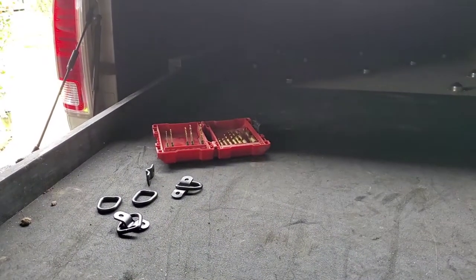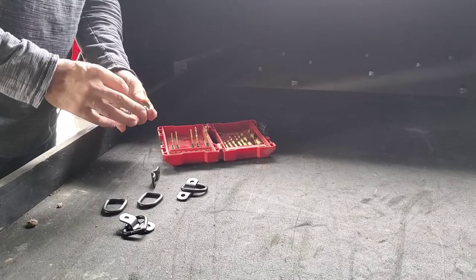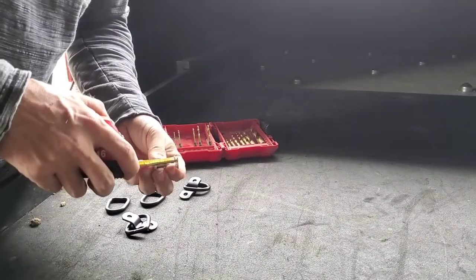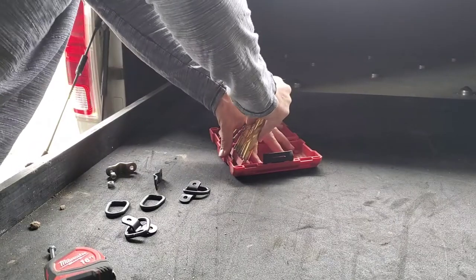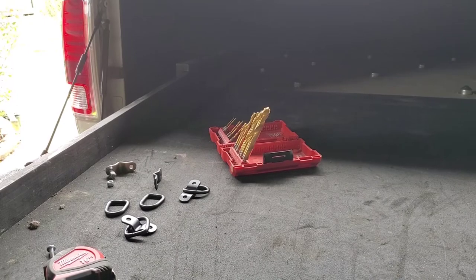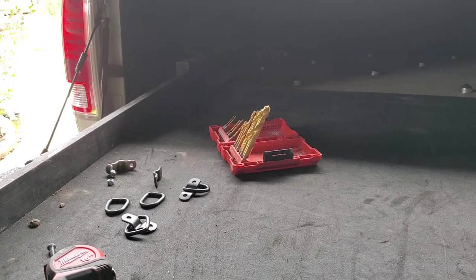It'd be all right. So the bolts we're using are 1/4-20 by 3/4 inch. I think they're 3/4, maybe they're 1/2 inch. Let me tell you real quick what they are. 3/4 inch. So now we need to get us a 1/4 inch drill bit and make our hole bigger, which in all reality, we could probably just use a 1/4 when we pre-drill the next ones, I would assume. All right, let me get the...